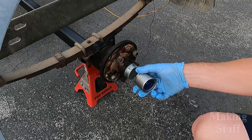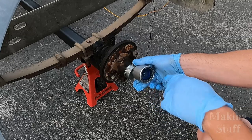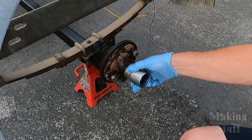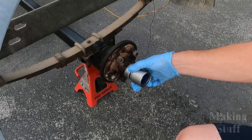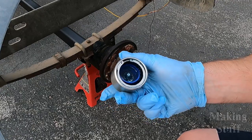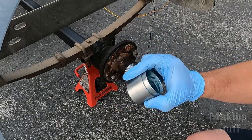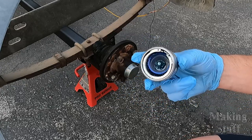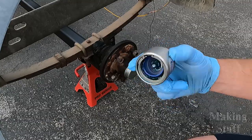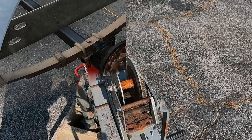that inner ring out. And then when I gave up, I tried to remove the grease gun from the Zerk fitting, and it would not let go to save my life. And now you can see it is messed up. So these are going back. Right now I don't have a pretty good opinion of bearing buddies. I know some people swear by these things, but I'm not impressed, and these are going back for a refund.